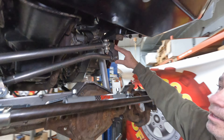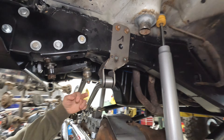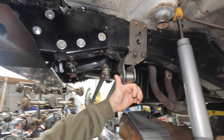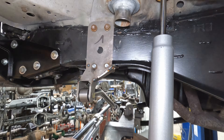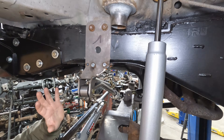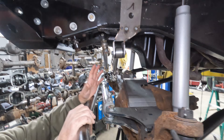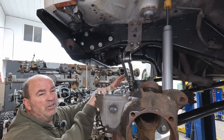The chassis-side bracket is pretty remarkable — we've pushed it outboard of the vehicle to make the track bar longer, and pushed it forward so we can clear the differential and allow for some wheelbase stretch. It's super stout quarter-inch plate, in exactly the right location, all engineered so you don't need to figure this stuff out yourself.